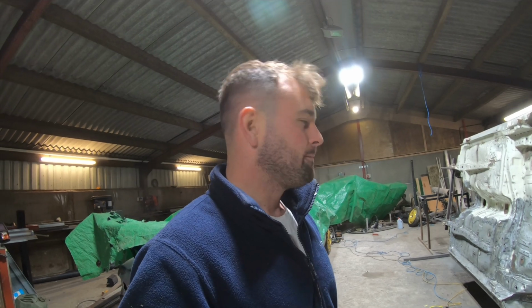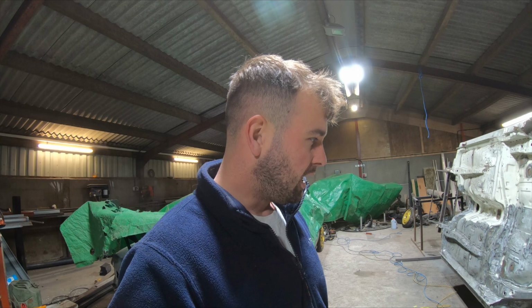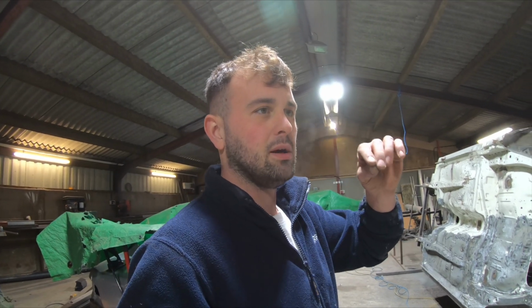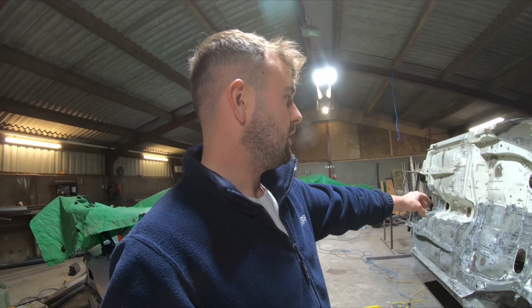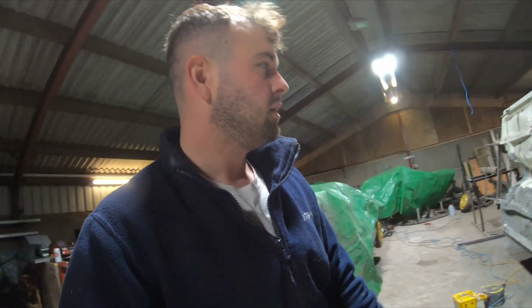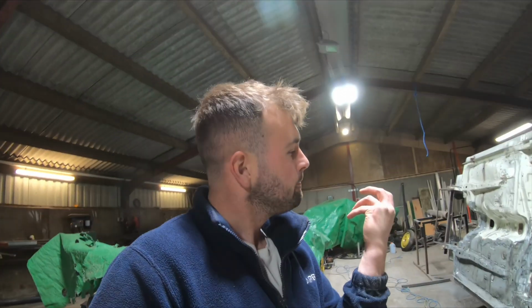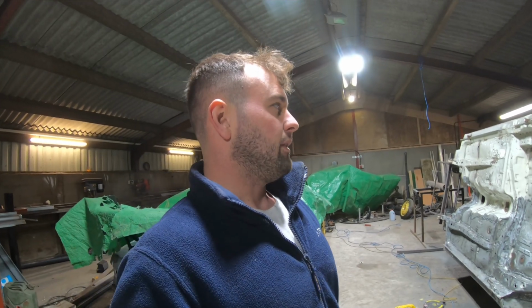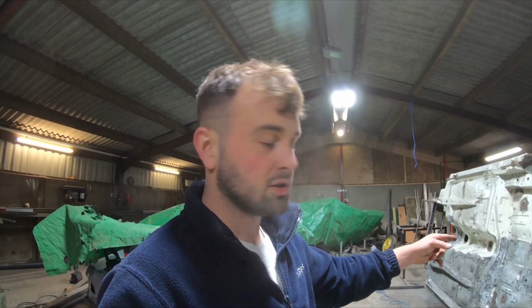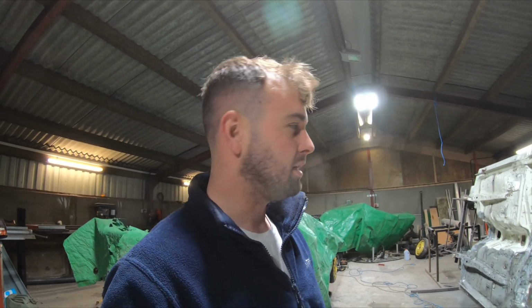And talking paints again, I was just talking to my dad. I'm going to initially etch primer it. It's got acid built into the paint, so it'll eat into the metal and make a rough edge, a key, same as sanding. I'm going to use Raptor etch primer, and I was initially going to do Nardo grey inside gloss and Raptor underneath for some durability.